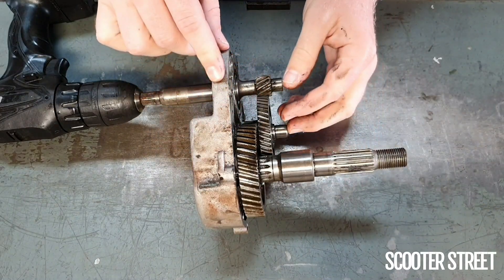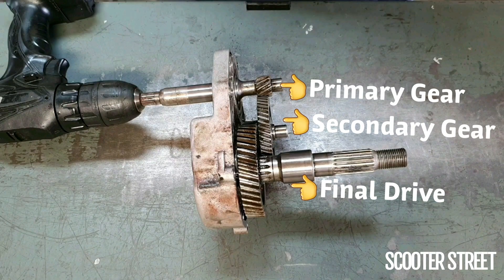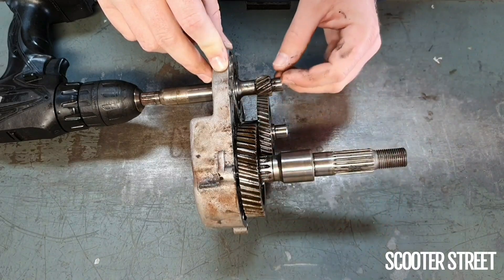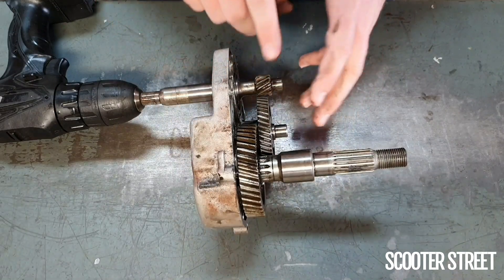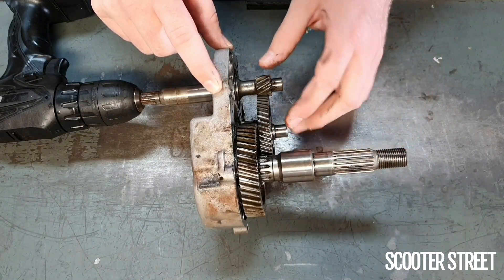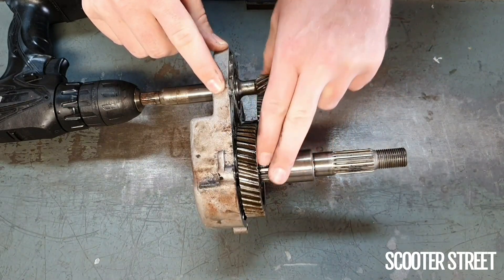Getting back to gear up kits, there are a few different ways of doing it. You'll see Malossi list a few different products — they list secondary gears, idle gears, and primary gears. Depending on the scooter and different models they make, some scooters, particularly Piaggio engines which are a favorite of Malossi, they make all the gears. With other brands you just change the one gear. You're really looking to modify this ratio, normally no more than about 10%. If you have a really high-end scooter you can fiddle with it a bit further than that, but with most scooters you're looking at between 5 and 15%, which is the range of the kits that we sell. When you do this, you'll often lighten the rollers slightly to compensate for the acceleration loss.